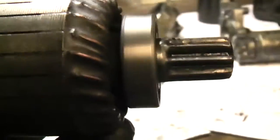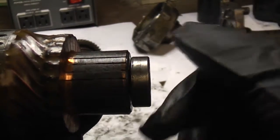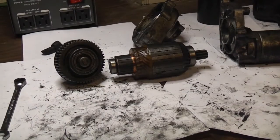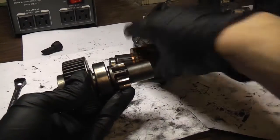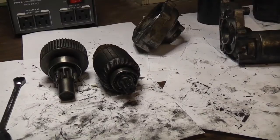Let's check the two bearings on the armature. There's another one — check this one. Wow, this one's even worse. It doesn't rotate at all when I let go of it, so this one is definitely shot. While technically you could just replace the brush holder assembly and get this starter motor working again, out of four bearings, three of them are bad. You would also need to clean and polish the commutator segments. That's exactly why I don't recommend rebuilding a starter — sure you could just fix what's broken, but the rest of the starter is equally worn.